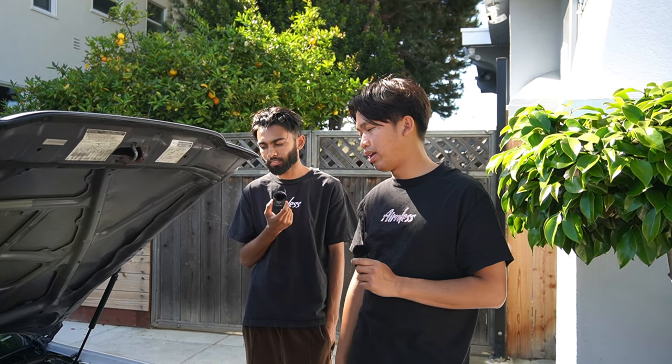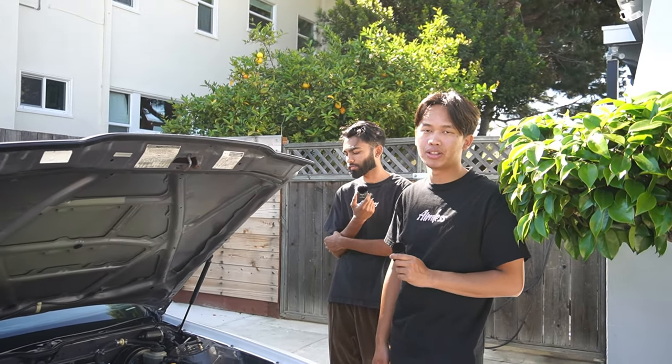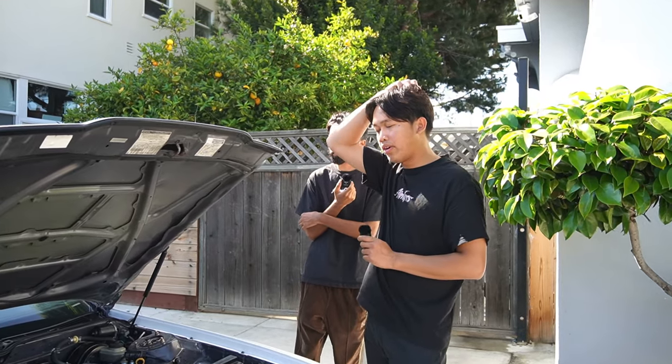So pretty much all OEM seals on it. I bought the seal kit from Lexus. It came with everything, all the seals. So it's like you did a 2J seal kit? No, it's for a 1J. They just had it at Lexus. Makes sense. And with a Tweak Performance harness, plug and play. I had no complaint with it. Stock ECU still, automatic stock ECU. There's only one thing that doesn't work on the cluster with this harness, right? The coolant temp, yeah. So I guess you have to modify the cluster to make it work.